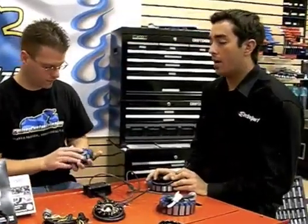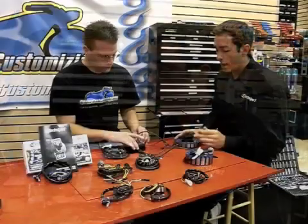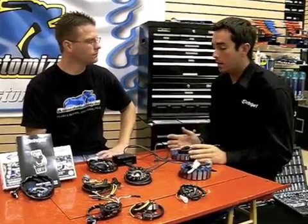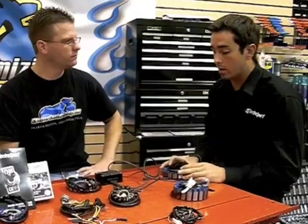If you're going down the road and your battery just quits and your bike just won't start, more than likely there's an electrical issue going on. It could either be the stator, regulator, or battery. The best way to check it is to keep an eye on it and check the current coming out of your stator. If it's below what the recommended service manual specifies, I would definitely look at replacing that as soon as possible because it's on its way to failing.